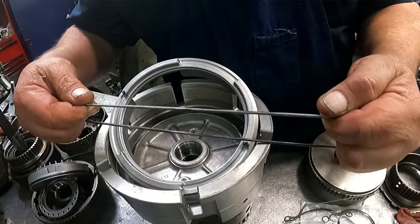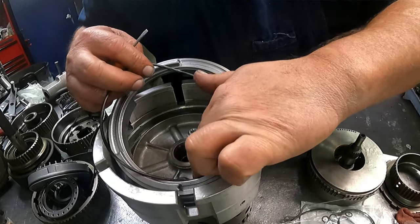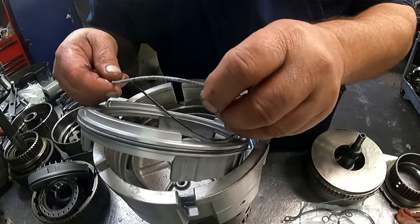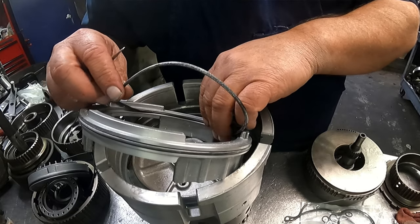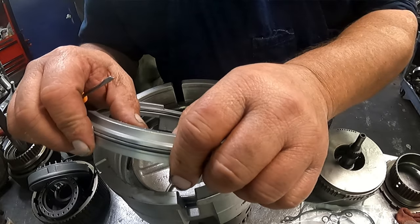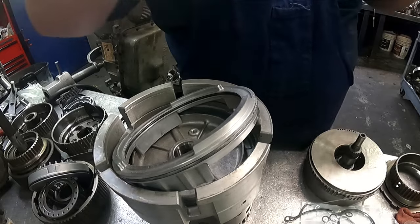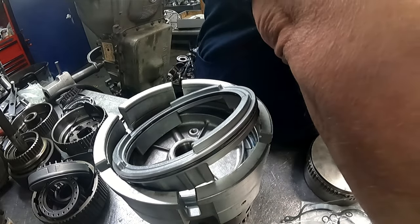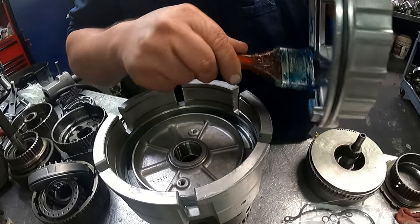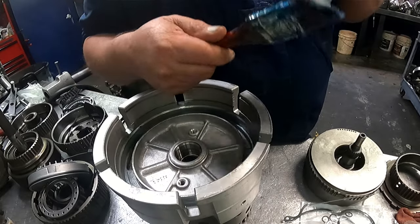So anyway, it's got the wrong crank in it, so therefore the torque converter that's in it is now wrong. And they keep wiping out pumps and torque converters. So I think we got it straightened out now. Get the right pilot on it, right torque converter. Should be okay now. What happened on this unit is it wiped out the converter. Luckily it did not wipe the pump out this time.